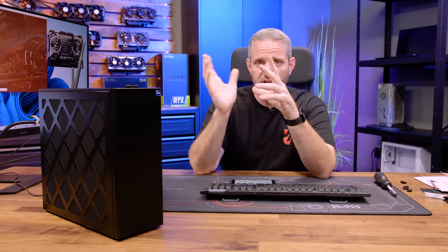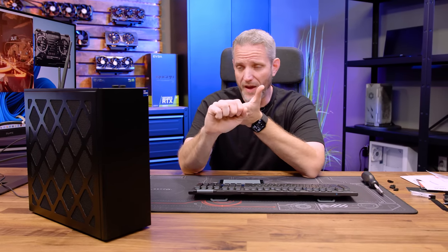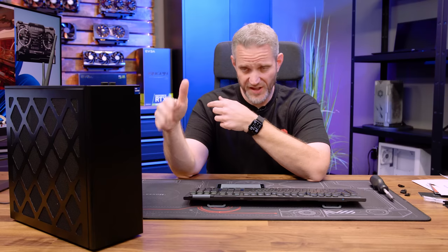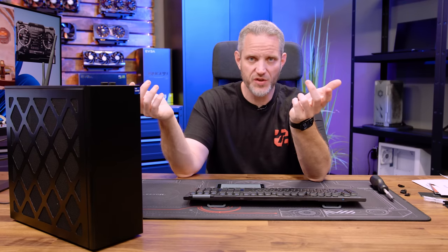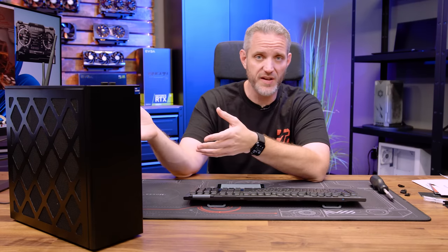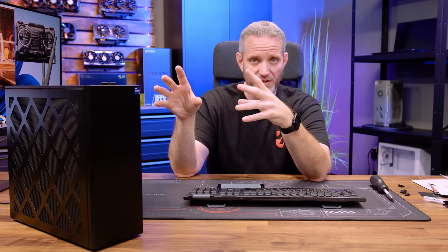This thing is kind of nuts, to be honest. So the NUC 13 Extreme — that's the family — comes as a bare-bones with the CPU, motherboard, power supply, and cooler design. Everything else — storage, SO-DIMM DDR5 memory, and GPU — is yours to figure out. I'm fairly confident the two Foxconn fans come with it as part of the cooling solution. I would highly recommend replacing those fans with better ones; fortunately they use standard 4-pin PWM connectors so you can swap in any fans you want — even RGB fans that'll show up on those four RGB headers on the bottom of the PCB. Their installation guide comes with very detailed teardown and build instructions.